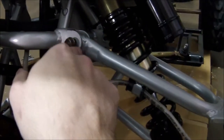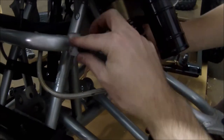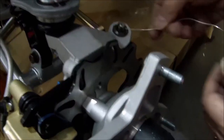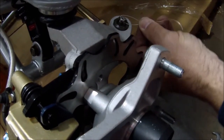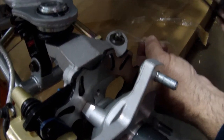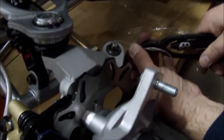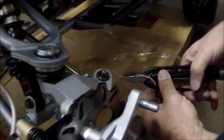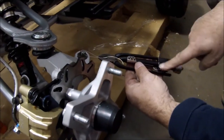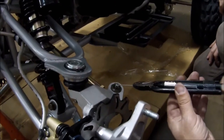Also with the uppers, you're going to be using the smaller ones. There are nuts welded to the other side — same thing for the other one. I'm going to use safety wire instead of a cotter pin, because it's what we do on all the race bikes. It's eight pounds of torque for the castle nut. So you squeeze these together and pull this down — see how it locked? And they go like this.